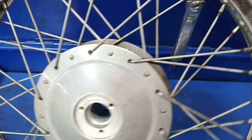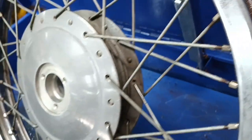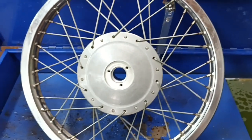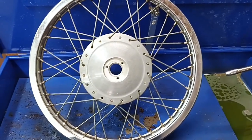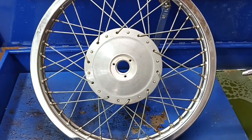Now, a lot of people, including the manufacturer of the machines, will tell you that you don't need to degrease before you put the parts in the vapor blaster. But I always do it. It makes the media last longer, it makes it less toxic to dispose of, and it really helps the parts look better.